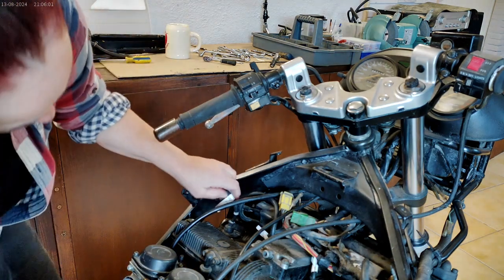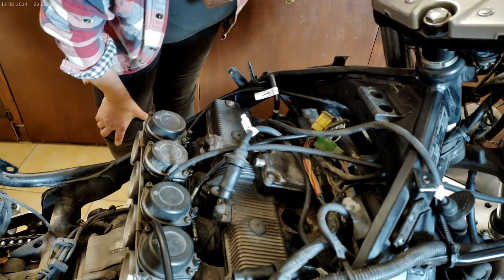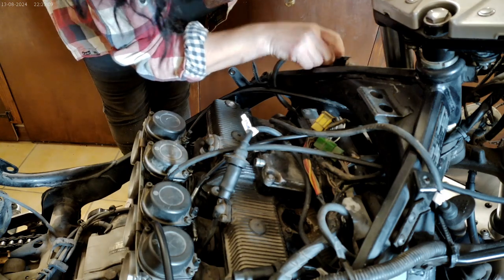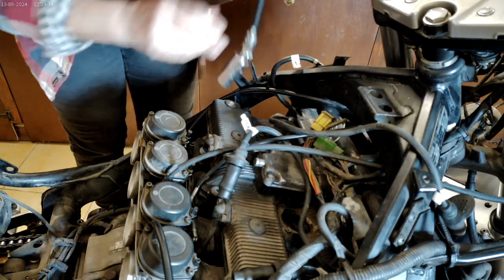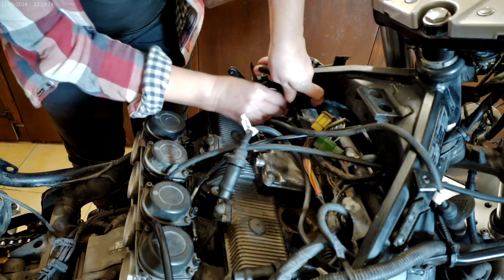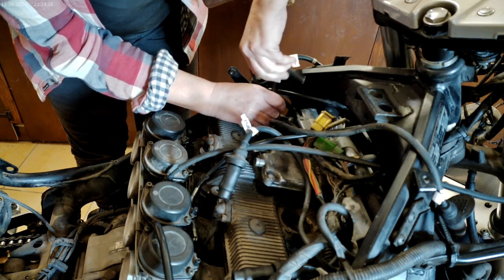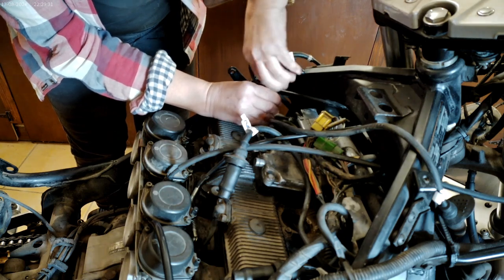Oh, do they just pull off? Does the cover just pull off? I'll show you how to remove the spark plug on my GSX. Literally pull the cap in case it comes off nice and easily. I've got a spark plug tool. Pop that in there. They are quite a long way down. Untwist, remembering righty tighty, lefty loosey.